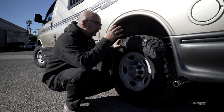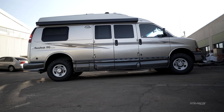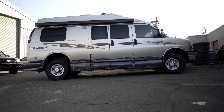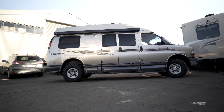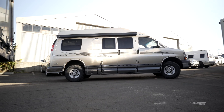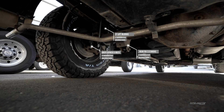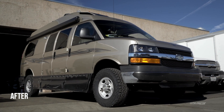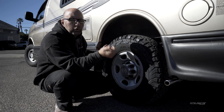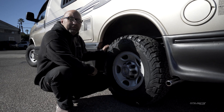We're in the back of this now. You can see just how much room this has. Even with the skirting on there, no problem - that 265/75/16 BFG fits without issue in the back of this. We did have to add a three-inch block in the back to get this up to height, as it did sit pretty level and low in the beginning. In the rear, keeping it simple: blocks, u-bolts, and then a set of Fox shocks. This thing is just awesome.